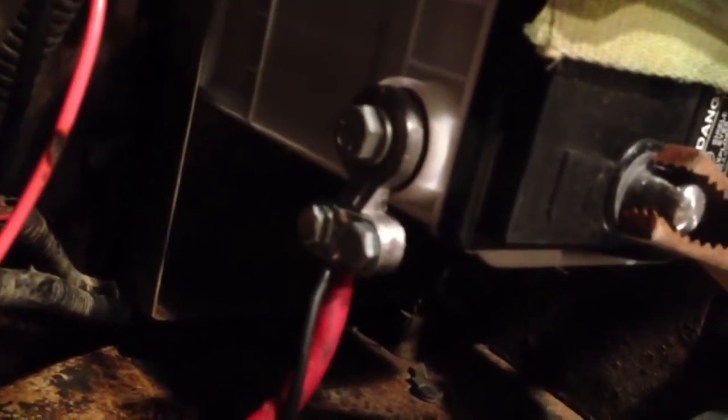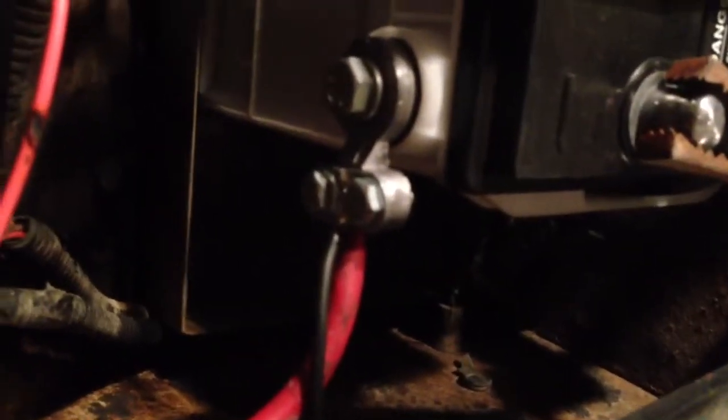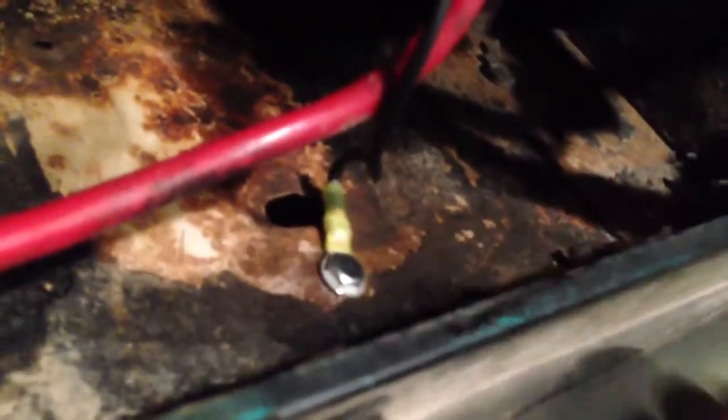And I believe the power randomly dying issue happened a few weeks ago, and then it happened when I was working on the alternator. With the first time I installed it, of the like 20 that I've taken this thing out and put it back in, was that ground wire right there to the body, which I replaced with a fresh wire and with the new battery connector to make sure it was getting a good connection. And then I used a wire brush to rough that up so we get a better connection and put a fresh bolt on it, fresh connector, and fresh wire. So I think that was it. I think it was a grounding issue that was why I was losing all power.